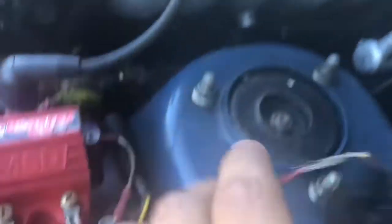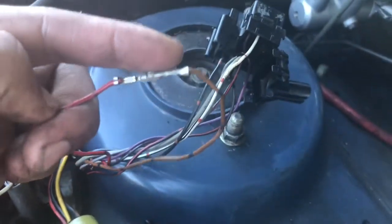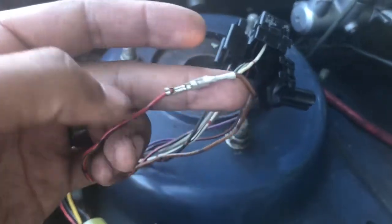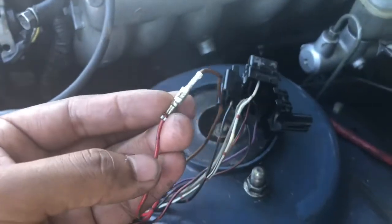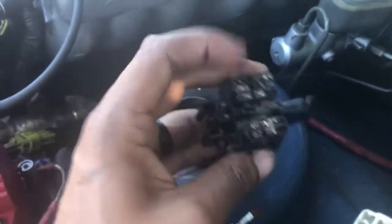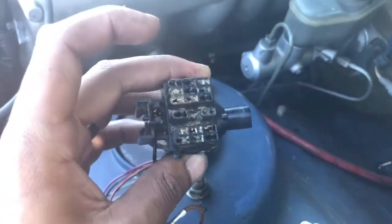I opened it from the back and took the two wires that I needed out. On that diagram it tells you to connect the E1 with the TE1 — so this is the E1 and the red one is the TE1. Usually in a lot of forums online you can find that you can connect a paper clip to one or the other.